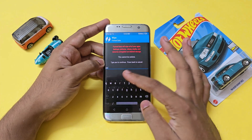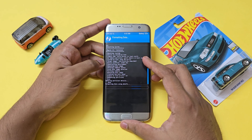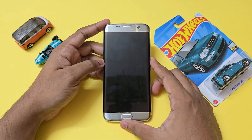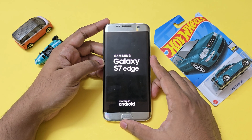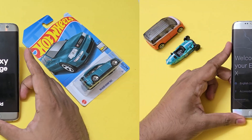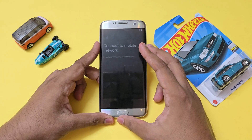This will take a couple of minutes. The ROM has been successfully flashed with no errors, and Magisk as well. Before rebooting the system, I recommend formatting your data — type in 'yes' to confirm — then reboot the system. The Galaxy S7 logo will flash a couple of times before it actually starts booting, then you'll see an Evo X boot logo.